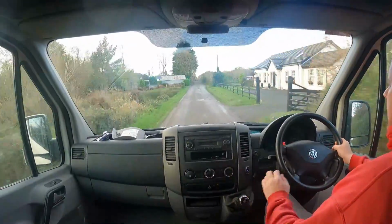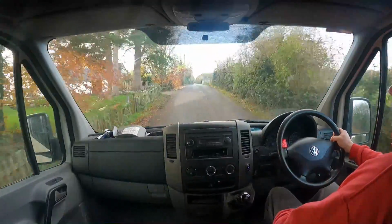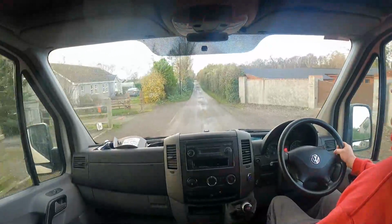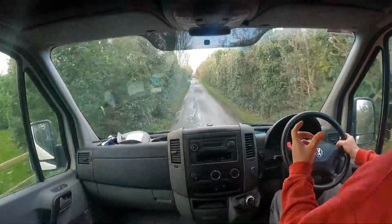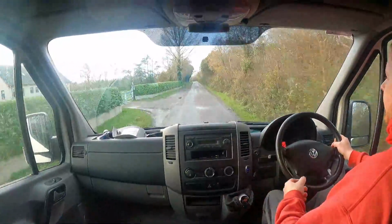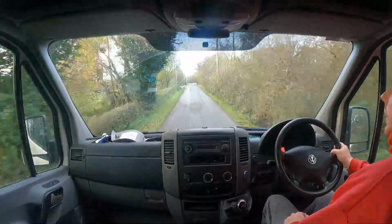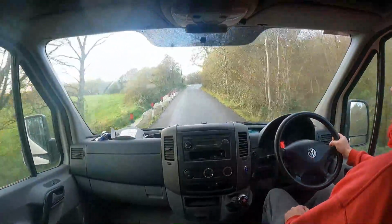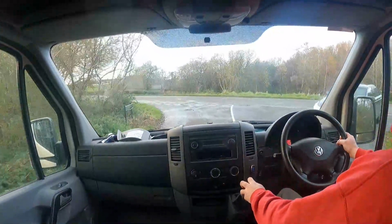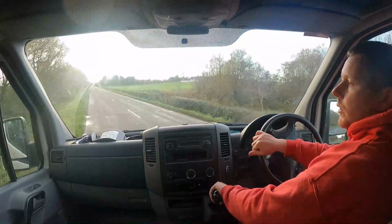So it's running dead on there, there's no lights or anything coming on. I had a wee bit of trouble with it. There was a couple of lights on. I changed a few parts in it, a wee sensor and a few parts, but it ended up being the bit that goes on to the intercooler inside the engine. I just hadn't tightened it up enough. It was letting air into the turbo and putting the two lights on, the engine management light and the other wee light with the circles on it. But once I did it and cleared the codes, it was running dead on after that.